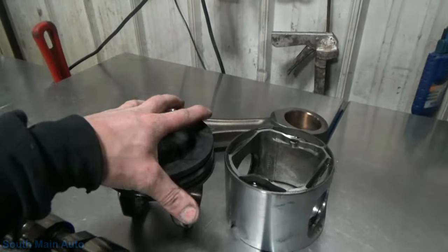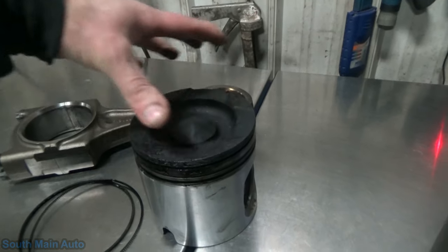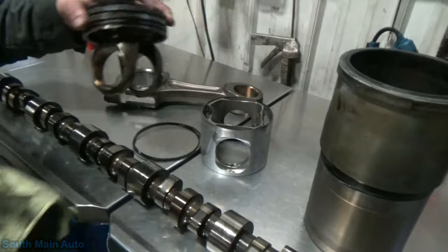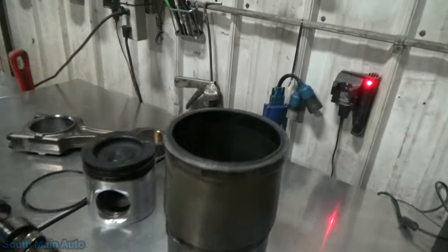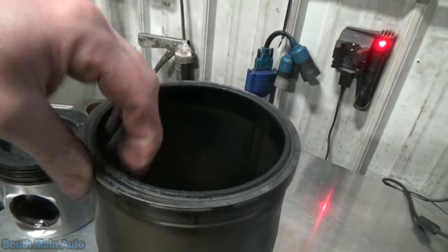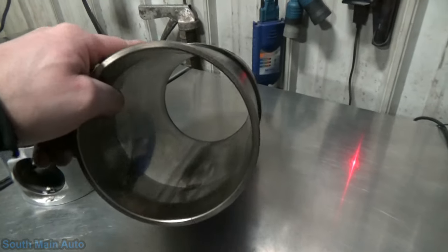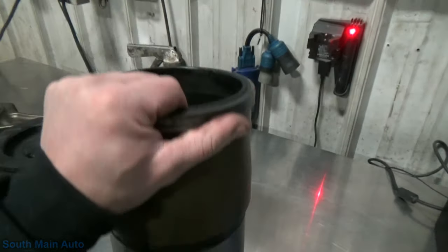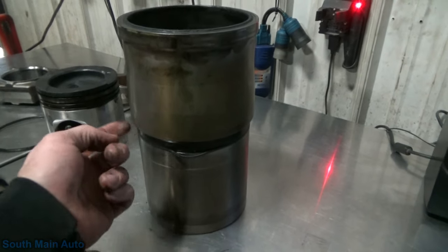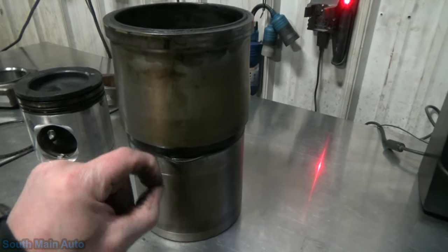You can see the size of the piston and wrist pins — these are two-piece pistons so the skirt kind of floats. These do have a little bit of movement when you put the wrist pin in. Cummins has since updated from a two-piece to a one-piece with an integrated skirt. These older sleeves were prior to an anti-polishing ring, which Cummins has gone to now to stop carbon buildup on the rings, as well as vibration damping. These are wet sleeves — they go in surrounded by coolant — so one little screw-up on installation creates a pretty bad day.